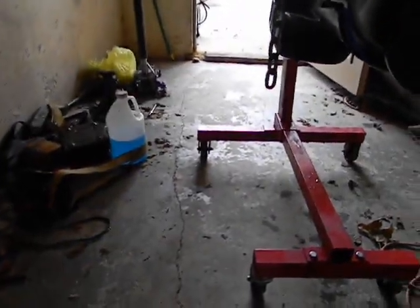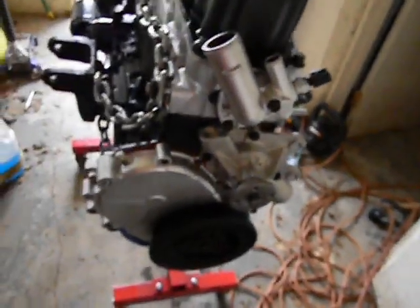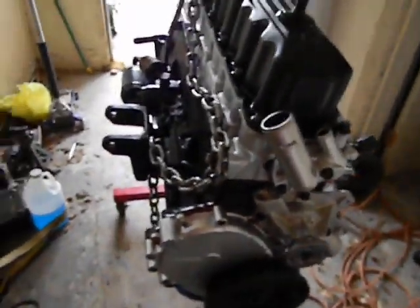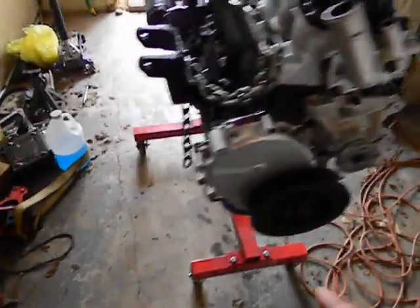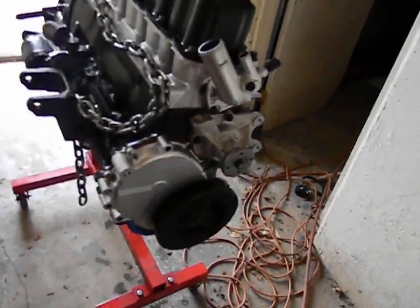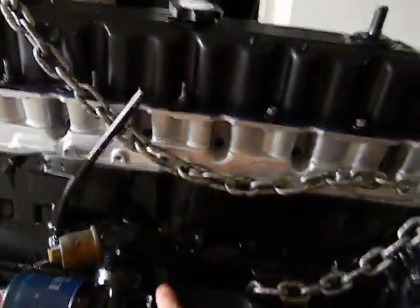Here's that motor - this is the '97 4.0, it's got the 0630 head on it which is good. I'm going to use all the accessories from the 4.2 on the front, at least that's the plan right now. I've been running into small fitting issues, but basically I'm going to carburetor this 4.0 using the intake from the 4.2 and the exhaust from the 4.0. I rebuilt everything - re-ringed it, lapped the valves, put new seals in, all new bearings and gaskets. I'm putting an HEI distributor on it.